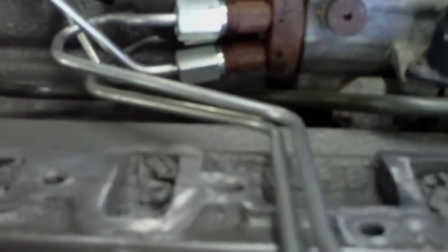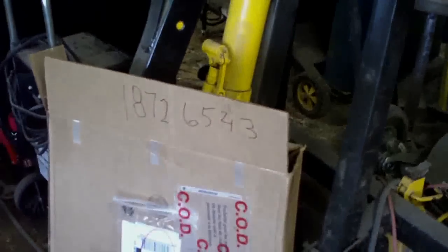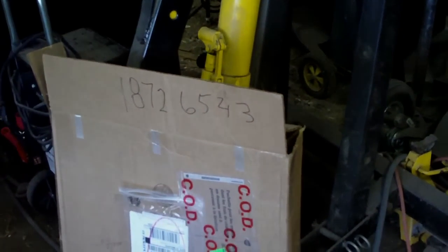And from there, I could figure out — I knew that was 6. And then from there, I grabbed number 2, and it was really obvious where number 2 went as well. And from there, I could determine what the direction of rotation was and where all the subsequent positions should be, because I took the firing order off of an intake for this engine and worked accordingly around.